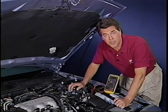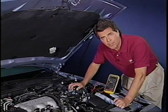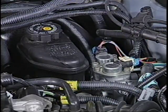During the next several ignition cycles, the ball screw is positioned higher. After the 5th to 7th cycle, the proper position is attained. Then the codes stop setting, but are retained in history. Installing a new modulator repairs this concern.